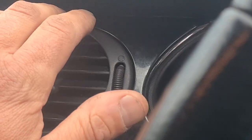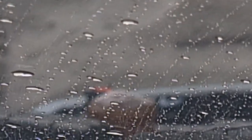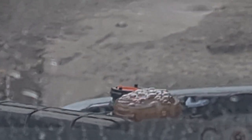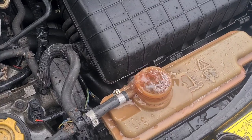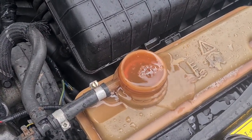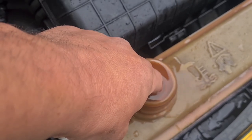When I rev it we get a bit of heat through the vents, but take my foot off the accelerator and it goes cold again. That means the K seal has been put into the engine and it's blocked up the heater matrix. Now because it's raining I'm sat inside the car, but look at that — bubbling away like a witch's cauldron. It's not supposed to do that. That's lots of exhaust gases escaping into the coolant and making it boil over, and it's not even hot.